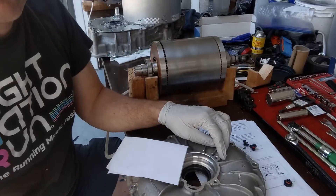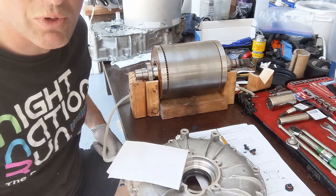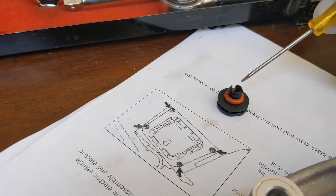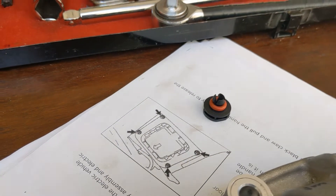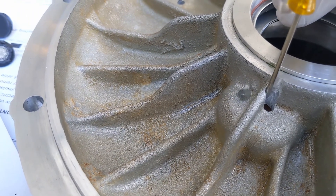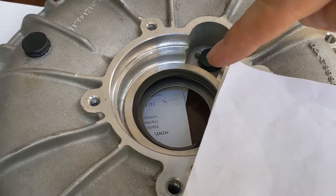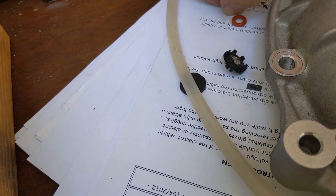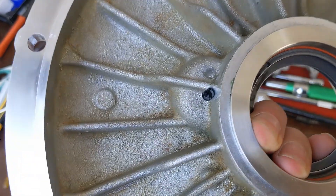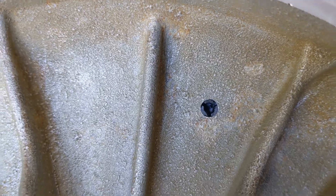With epoxy, I'm going to glue it in there. I already tested that the epoxy bonds very well to both the plastic and the cast aluminum. I also closed this hole with epoxy, drilled a new hole in the center at 5.5mm, and I will put in this breather after cutting off the three taps. Unfortunately, the hole coincided with the rib over here, so it would have been better to put it slightly eccentric. New breathers are on, in epoxy there and there. There's enough space left so that the speed sensor fits in — I checked that. I kept off the rubber rings from the new breathers, otherwise it would not fit. You can check on the backside if there's no epoxy blocking the membrane — and it's good.